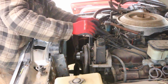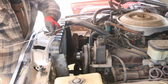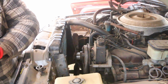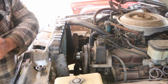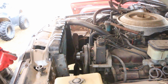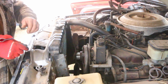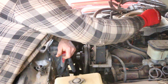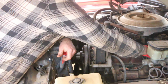Okay, it winds over. Let's see if there's any engine oil in it. Oh, there's oil. And it actually looks half clean. Let's get a feel of that. See how it feels. See how it smells. Smell like anything. Oh, that's nice. I'll tell you a little secret about oil being nice and tidy. This thing ran on propane, and propane engines don't put near the amount of carbon and soot down into an engine that regular gasoline operation does.